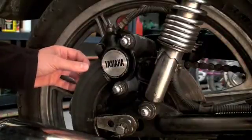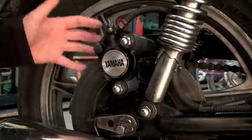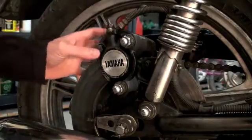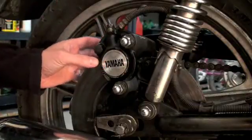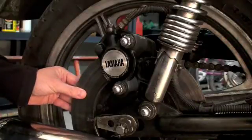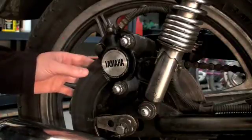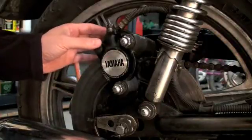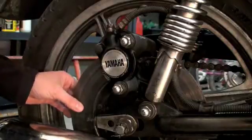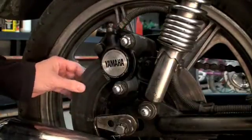A problem happens in a lot of these old bikes where old crud, rust, and dirt gets caught in around the seal on the pistons inside the caliper. That old dirt keeps the piston from retracting enough, so it keeps a little pressure on the disc and causes the disc to drag. Having dragging discs can be really dangerous because it basically means that the brakes are always applied a little bit, all the time. This can cause heating in the brake disc itself, and it can also cause the brake to seize up — even a major rear wheel seize up while you're driving along. And nobody enjoys that.